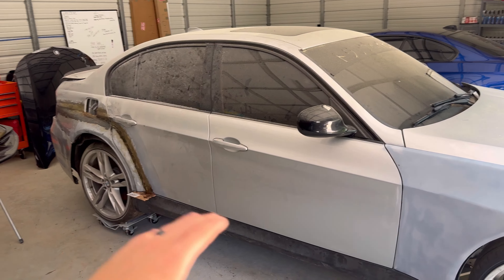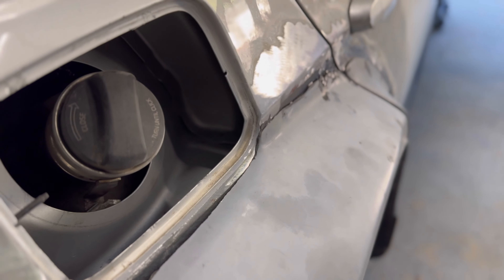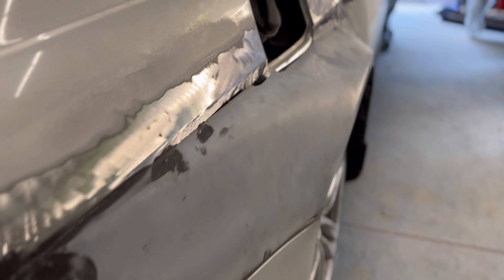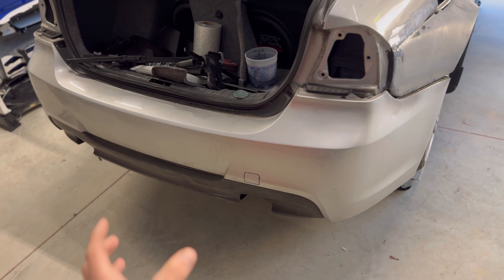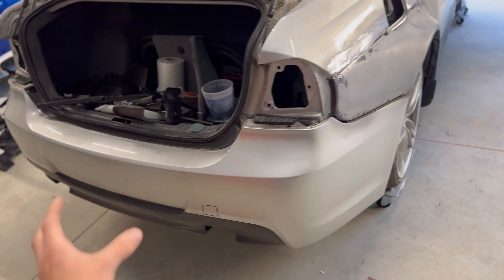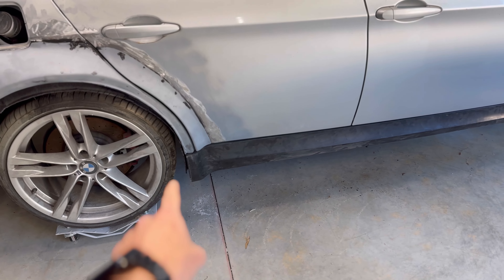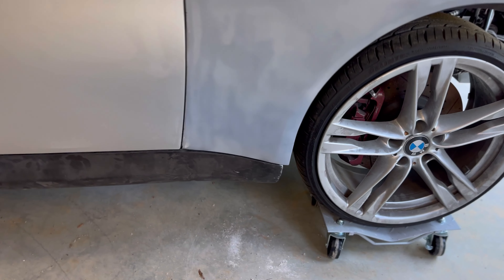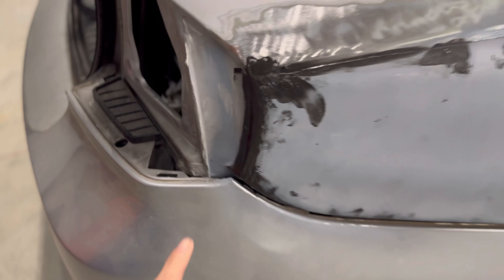As you can see, we have the whole car molded up, the body panel on the car, everything ground off, and we're about ready to go. Not exactly flush in every spot — I don't know if the mold just cured too quick or wasn't formed correctly — but for the most part it fits pretty well. For the rear, we opted not to use the bumper from the kit due to having to remove reinforcement and drill holes; it was just a really weird bumper. We're using the factory bumper, cut at the proper angle to match up. The side skirts also have wonky fitment and don't line up consistently — not flush in the middle but flush at the back.